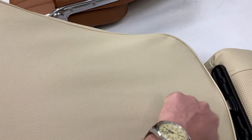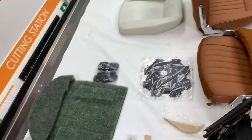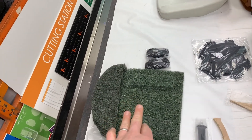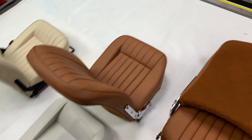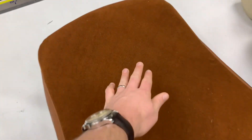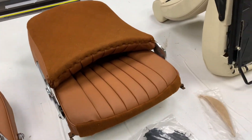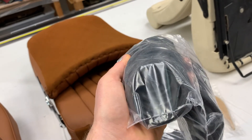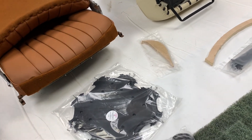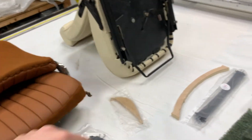There's a piece of moulded plastic behind there which incorporates that section — it's all related to the headrest and keeping the sturdiness at the top area, so you'll need a pair of those. Then you need the webbing kits, which are effectively the diaphragms but for the backrests — behind here you get some spring, you can feel it though you can't see anything. On the 4.2s there are rings all joined together by hooks. We do not supply the hooks — you need to reuse your old ones or use hog rings if your old ones are worn, and they're all joined then put to the frame to act as a spring.